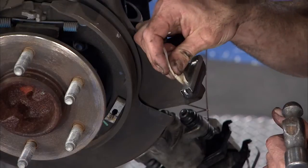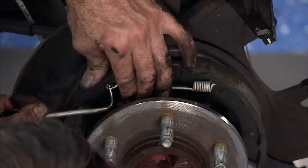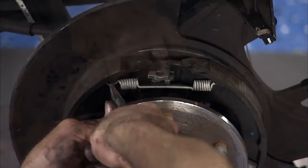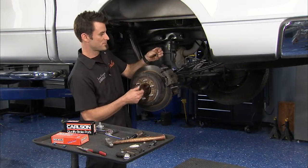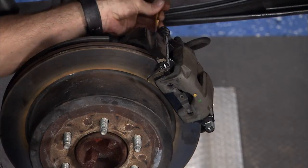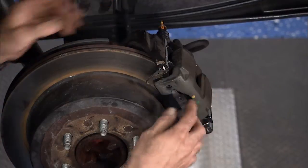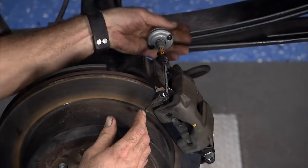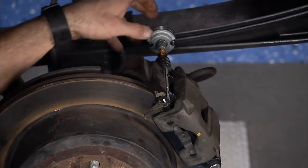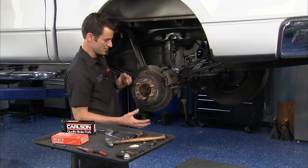Carlson already includes some lithium grease, which is nice. I'm going to put them on here and then the pad will slide back and forth nice and easy. Last piece to put in are the slider bolts that are replacing the originals — those will just screw into the back. Now there's only one dampener — this is the low frequency dampener we talked about before — that's going to go right onto that once you torque it up. There's only one on the top, not on the bottom per the instructions.